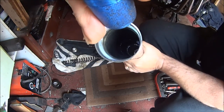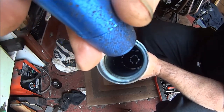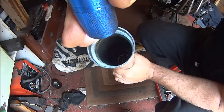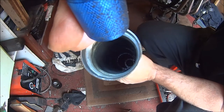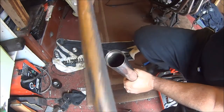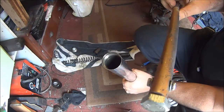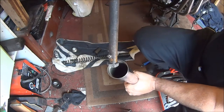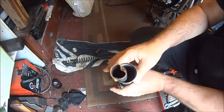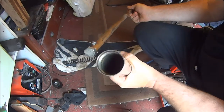I don't know if you can see down there — you should be able to. You can actually get a piece of pipe or a long piece of bar, drill it all through and attach a bolt to it. Usually it's a 17mm socket size. So I made this up with some old copper pipe when I did my GPZ forks and my Triumph Sprint forks and it worked perfect, but this is not big enough. I need a lot bigger nut to attach into that thing down there.